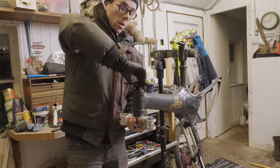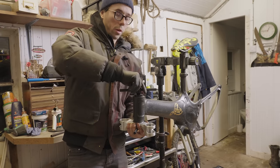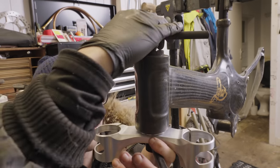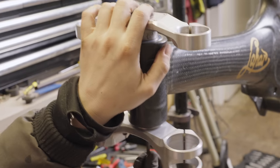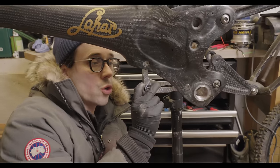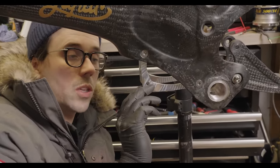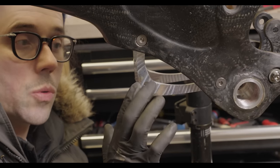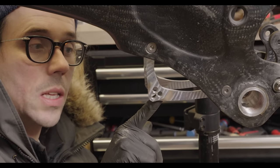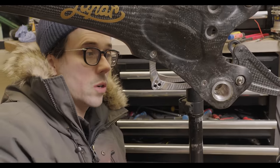Using my bearing press to press the bearing into the frame and make sure that the crown's on full travel. To accommodate the new shock, which is a metric shock, I've had to get new plates made up with a slightly longer hole. But these ones are also adjustable - they've got the standard hole, a slightly longer hole, and an even longer hole, which will accommodate the EXT shock that I've got and I'm fitting.